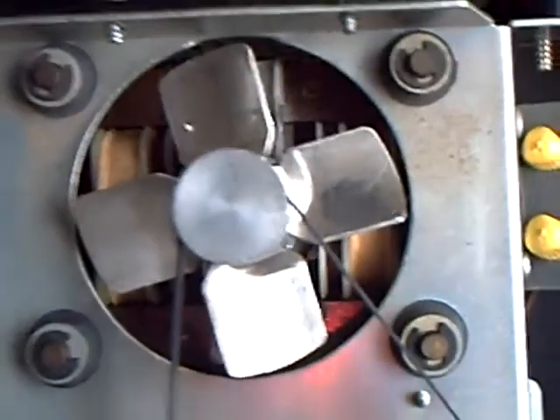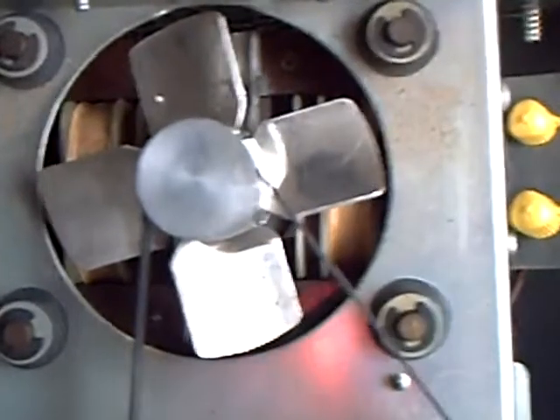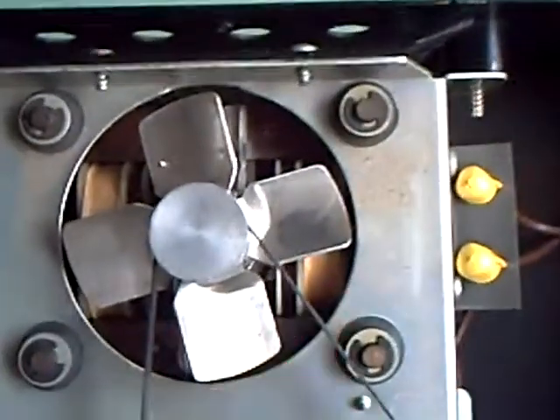It's only powering a pre-amp on this thing. This was quite a common way of doing things back then and on into the 60s and 50s. You'll find in a lot of little old record players — the orange box type with the lid on top and the speaker on the front and two or three knobs — that the amplifier drew its power from a winding on the motor.